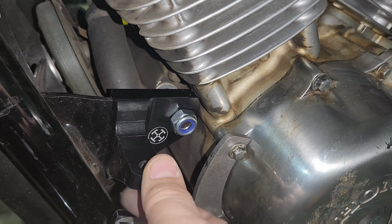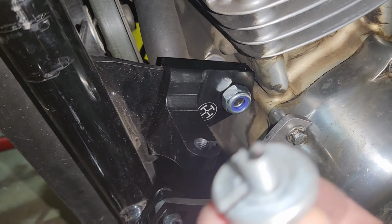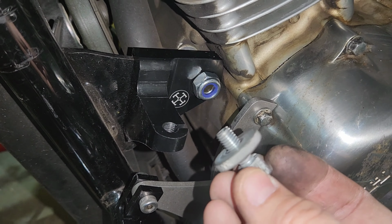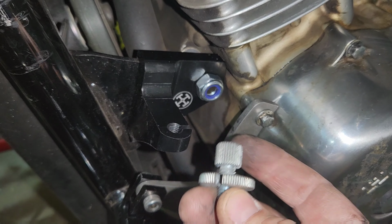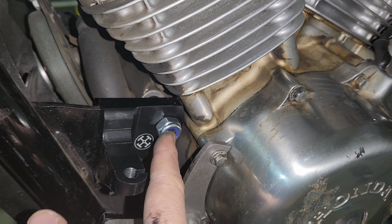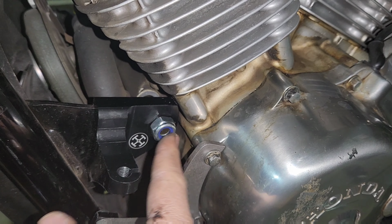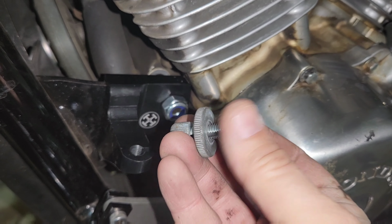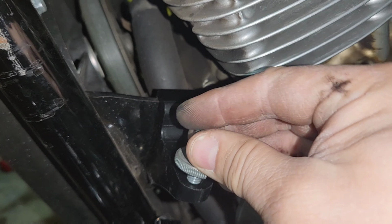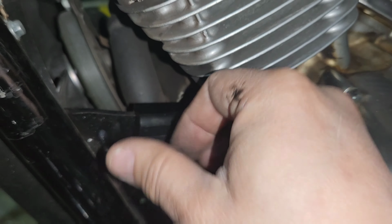And then you will mount this part, which is where we're going to put in the part to adjust the clutch cable and lock it in place. Plus, they send you a nice replacement to replace the acorn with a nylon lock, so it'll lock tight in there. It won't come backing out. Anyways, then you take this part, and you just screw that in. Like so.